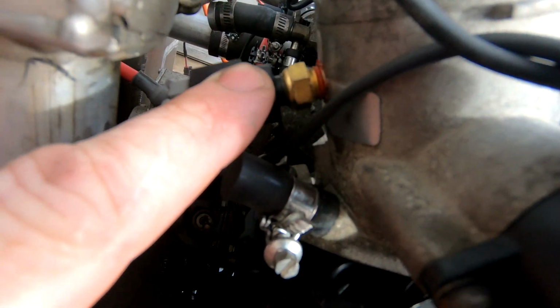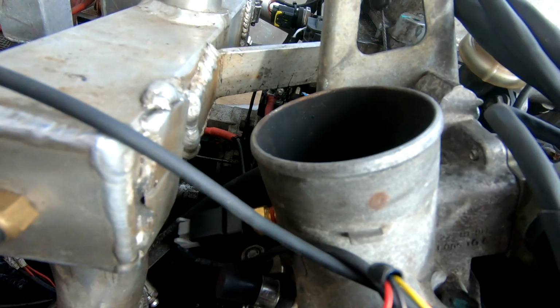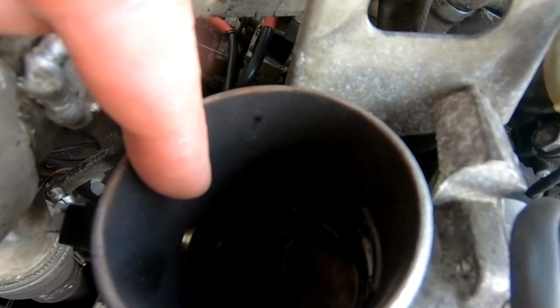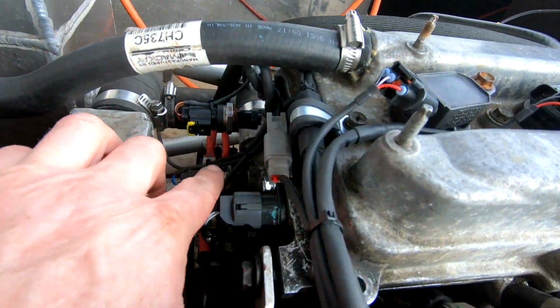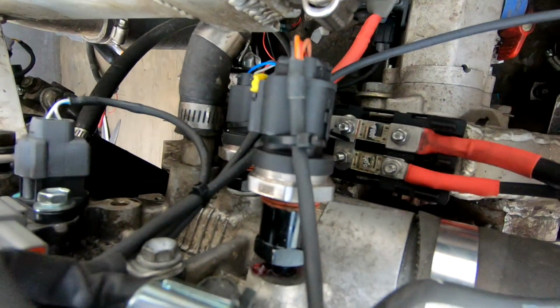We've done a couple of things different. Air temp sensor. They suggest just before the throttle body, or just before the throttle butterfly. Yeah, it's so close. It's right beside the throttle butterfly. We've checked it won't touch, and I've used these fellas. Let's have a look. Those ones.